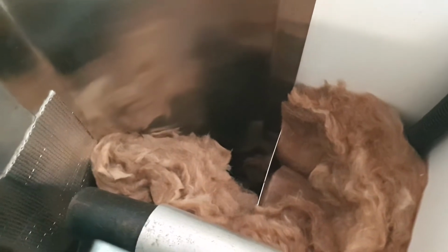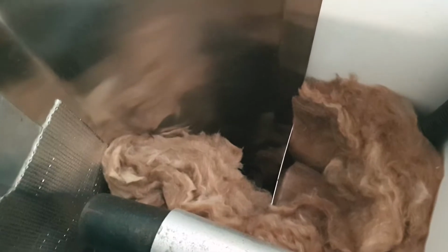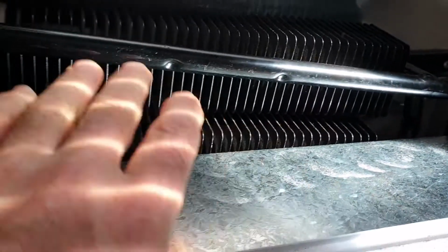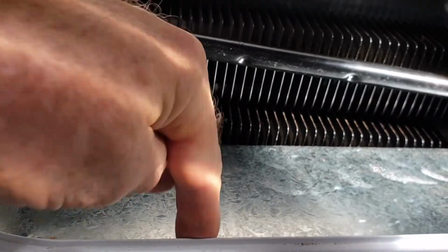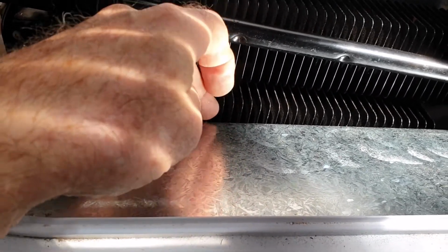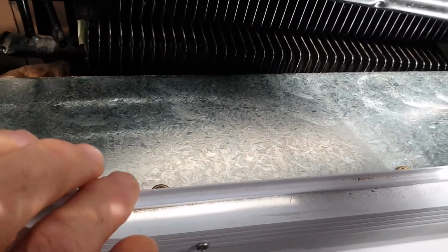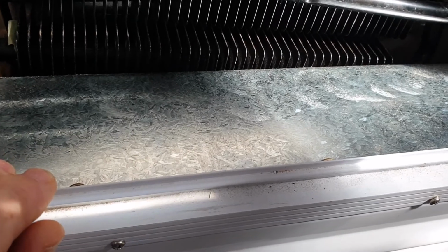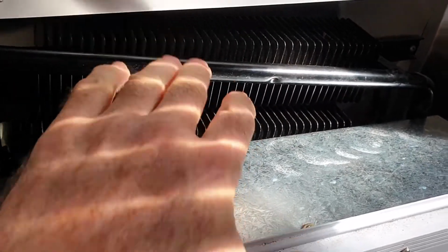So you have to close off any other portal, if you like, from the bottom vent to the top vent. So now this is forced to go through this heatsink. That is the only path, because the other thing I've done is put this baffle in here. In this van, the distance between the back of these heat sinks and the back wall was 140 millimeters. That's way in excess of the Dometic's recommendation, and anytime you got up here and checked it, there was just air coming up. I mean, the heat creates an effect here, but it wasn't going through here.